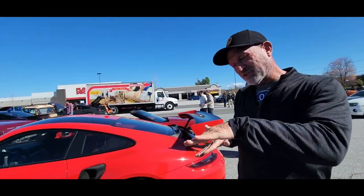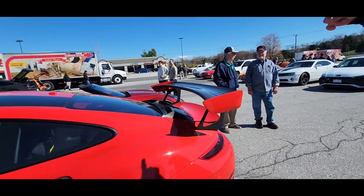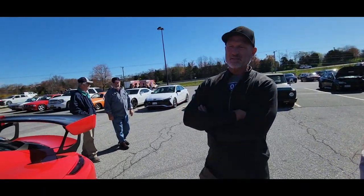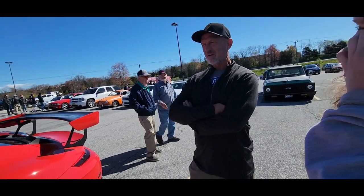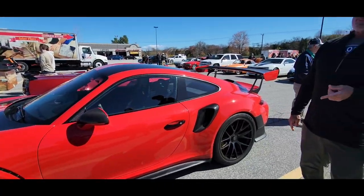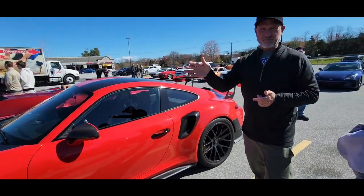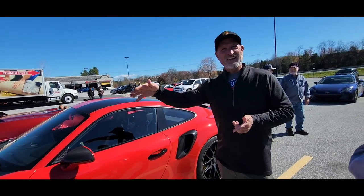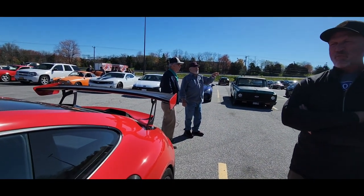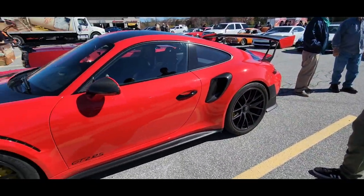Are these ceramic brakes? Yeah, of course — you've got them on your Camaro. You've got to get them really hot for them to really be working. The nice thing is I have an AMG GTR track car — 900 horsepower — it's got carbon ceramics. A lot of people don't like carbon ceramics because they get so hot — you can't touch the wheel for half an hour after you're off the track. But there's no fade. If you go with iron brakes on a heavier car you start to get fade — by the end of your session you're braking at marker 5 instead of marker 3 because of so much fade. These carbon seats are comfortable too — I've got some carbon seats from other cars I can't even sit in.